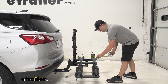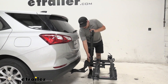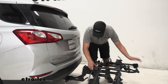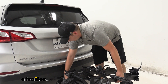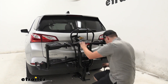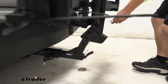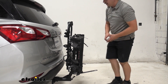As far as the back end goes, we're adding twenty-eight and a half inches from the back of the vehicle — not too bad. It is fairly condensed but we can fold it upright when it's not in use. We come here to the mast, undo these little rubber straps, and that'll free up these handles to be opened. You can then fold down the mast, re-engage the handles, and re-secure those straps — those straps are just to ensure the handles don't pop open accidentally. From here there's another pin and clip down near the hitch that we can pull out, rotate the bike rack up, and re-secure it with the newly aligned holes at the bottom. You do have to wiggle it around a bit to get the correct alignment, but once you do we've got a much more condensed bike rack, now only adding about thirteen inches to the back of the vehicle.